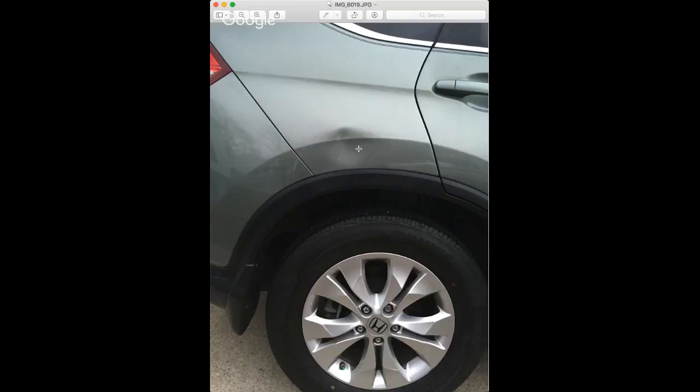But I would definitely start this dent with glue, 100% with glue. I get the majority of that lineup with glue. Probably spend at least 15, 20 minutes getting that lineup while I'm knocking down the crown. I think you can glue pull the center first just a little bit. You're not trying to pull the whole entire dent up. But once it starts to move, you definitely have to address this crown right here. And I think you can get this dent about 90% with all glue. But I really think you're going to have to finesse a little bit.